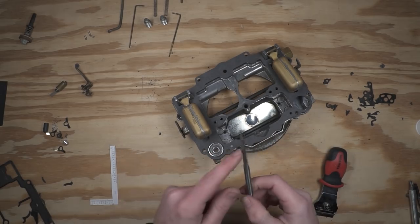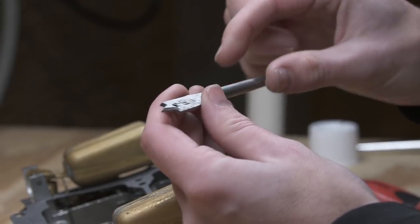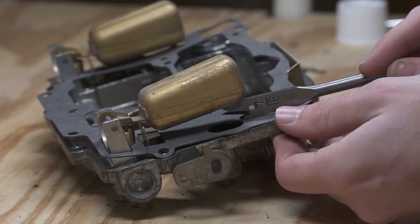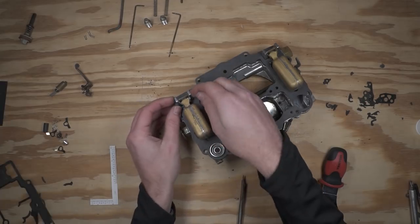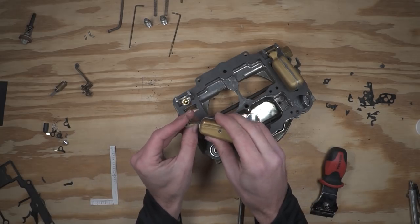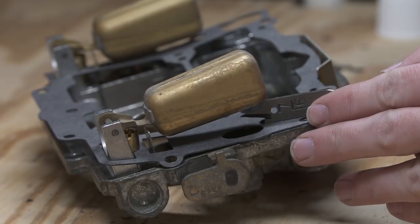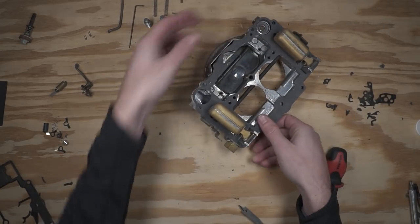What I really recommend is some type of drill bit — specifically a standard wood bit, using the 7/16th shank on the end. That way you can just slide that right in between the gasket and the float and you can tell if it's about right. You can see on this one that the float is just a little bit low because it's contacting that bit. As tempting as it is to just wedge on the float, you'll actually want to take it out and use a set of needle-nose pliers and bend it just a little bit there. It looks like that's going to be just about right — it's just touching here on the end. I'll duplicate the process on the other side.